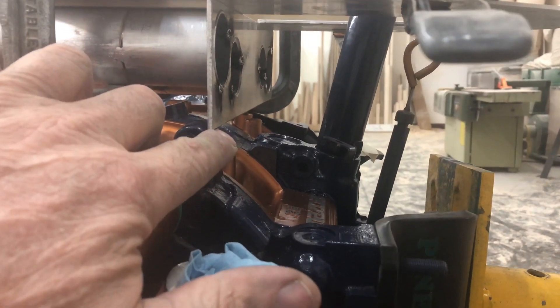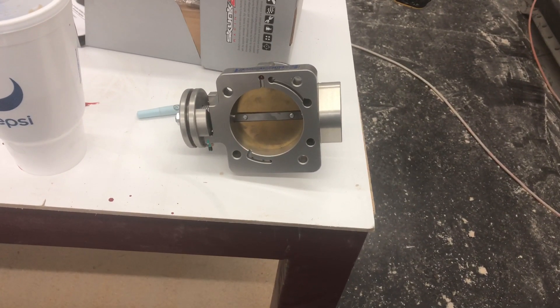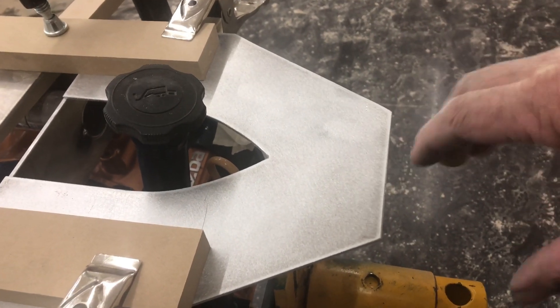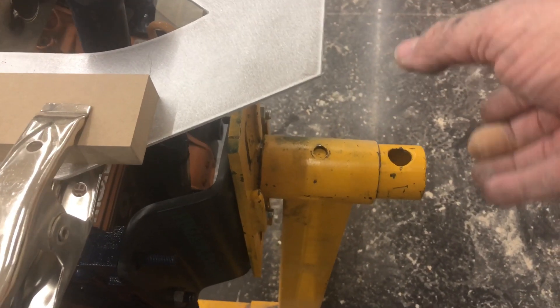I don't have any more room to make it fatter here because it's right next to the motor, but I can bring it down out here and not be in the way of anything. I'm having to do that because my throttle body is a 70 millimeter — I actually would have preferred a 65, which would have been a quarter inch smaller. The height of this is just over four inches, so I've got to make sure I have that on this back plate as the throttle body will be bolting right here on the end. I'm probably going to put a 90 directly off of here and then set the throttle body back here, but I'll work that out once I get this plenum box in place.